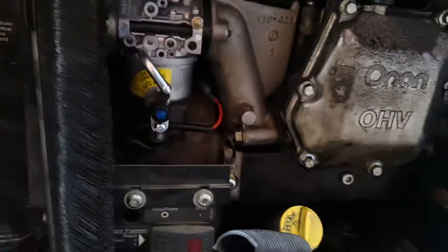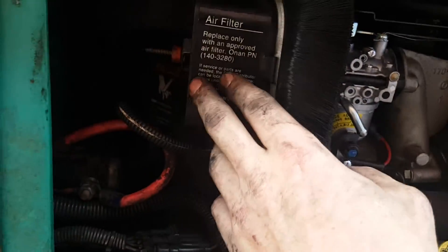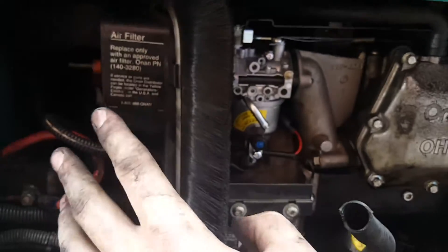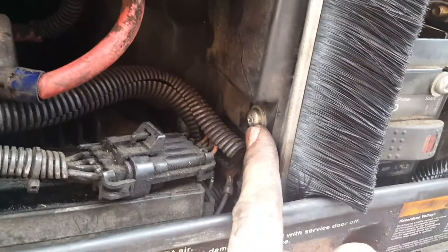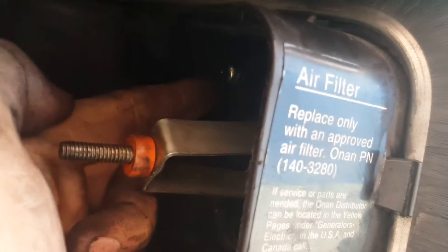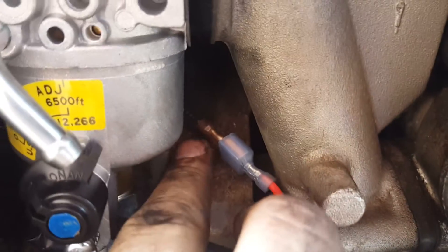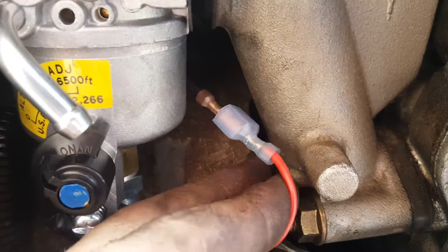After you take those bolts out this will free up, but this piece is part of the entire fan shroud and moves with the entire engine, so it doesn't come out that easily. What you have to do — and there's no way around this — is take out this T30 Torx here, and this T30 Torx up here inside the air cleaner housing. You can just see the shiny head at the end of my finger. There's also a T30 for the ground wire for the carburetor. Don't pull on the wire — grab a pair of needle nose pliers, grab the base of the crimp, and pull on the end with your finger. That pops right out.